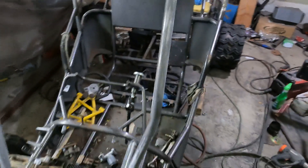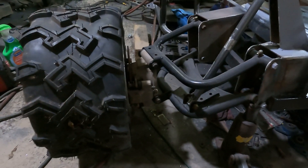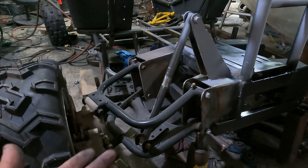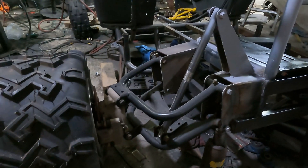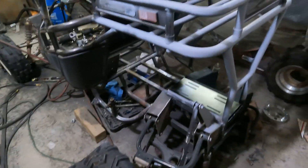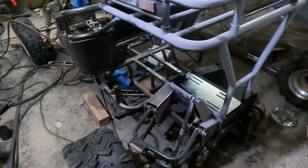I'm going to put dual seats with four-point harnesses in this and add more bracing for the roll cage. In the rear, we have RZR suspension — upper and lower control arms with the spindles and brake calipers. This took a lot of work. That bar is where the shock would go — I knew the measurement eye-to-eye from the listing, but I didn't have time to wait for the shocks to arrive, so I fabricated the shock mount ahead of time using a piece of pipe drilled center-to-center, knowing I could adjust it later since they are a coilover design. If you want to see more of this project, leave a comment down below. But until then, guys — keep on wrenching.